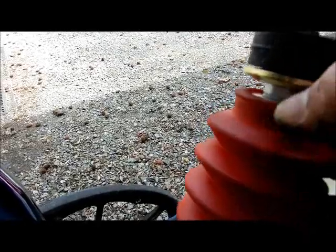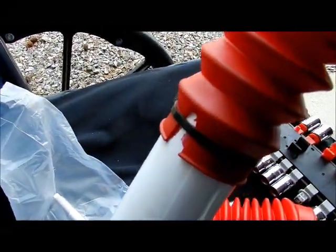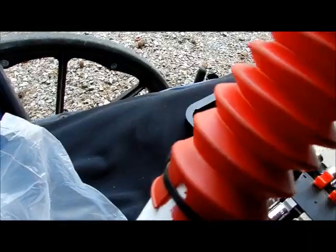So on this guy over here, you need to pull the shock all the way out. It takes a little muscle to do that, and then you bring your boot down and place it in there, and then it goes pretty well down the shock itself to be fully extended. It included a zip tie, so I went in and threw the zip tie onto it.